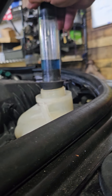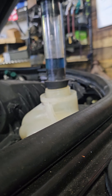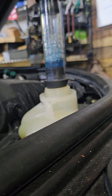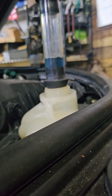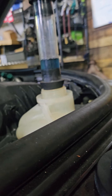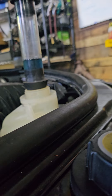All it checks is if there's exhaust gases coming back into the coolant, which shouldn't be — it should be going out through the exhaust. If it comes back, that means somewhere in the engine there's either a crack or the head gasket's bad. So we're going to start it up and see how long it takes. You can hear it running bad — it could be injectors, spark plugs, or whatever, but it's very loud. We're going to run it a second or two, see how long it takes for the bubbles to come through there, because if it is making pressure, back pressure from the engine, it's going to push it into the cooling system.